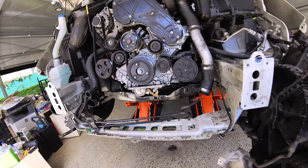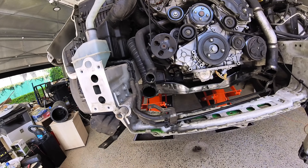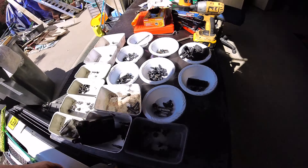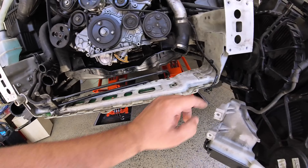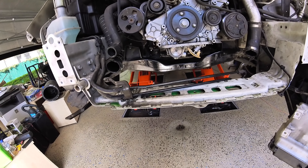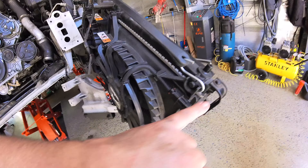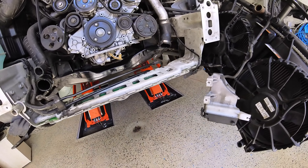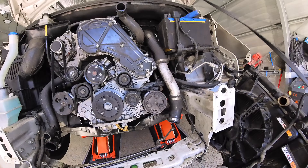Of course, if you've got a bull bar, that's got to come off first. Once you get that off, go to your support bracket - four bolts and one bolt here - and that will come off. Once you get that out of the way, you can undo your intercooler: two bolts here, two bolts here, bolt here, bolt here, and a plug. Take it out from the back. You've also got your hoses, and you've got to drop your coolant. On the back of the radiator you'll have some brackets - two Phillips screws here. To get to one side, you have to remove the coolant reservoir: two bolts here, one bolt here. One bolt up here for the radiator, and then you can start to manipulate and move it out.